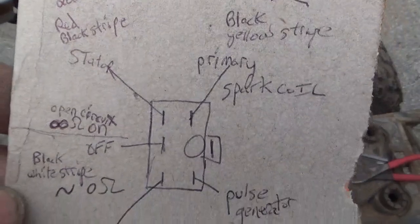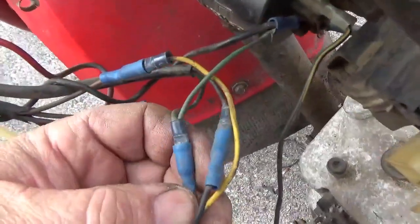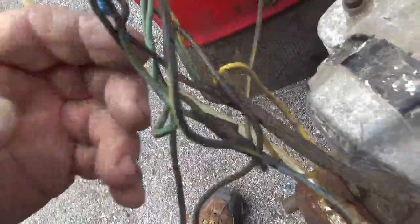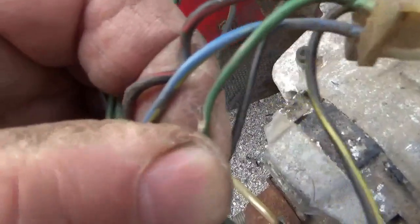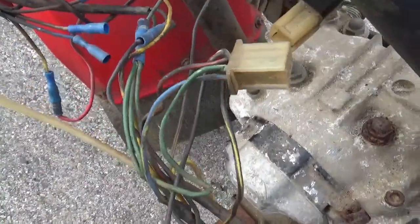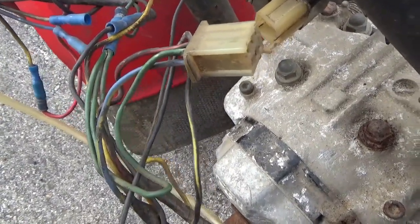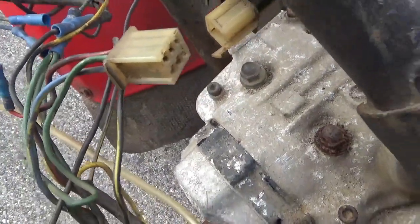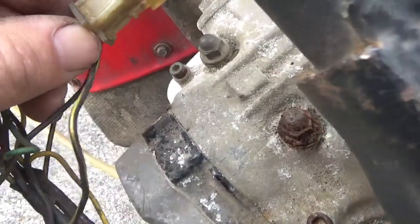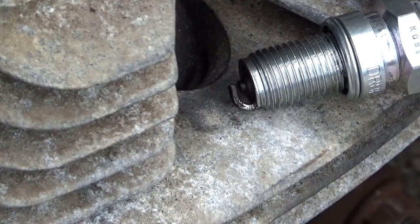Let me scan this down so you can see. I did find a couple of things wrong: first, this was unplugged, and second, if you look at the wires here, the ground wire has a nasty abrasion and is a little bit frayed. It shouldn't be a problem since it's ground, but if it were one of the other wires it could kill your spark. So I'm going to plug this back in and see if the spark returns — see if we can get this puppy to start and run on its own ignition system. Let me show you that it's actually sparking.